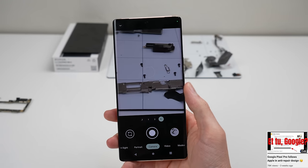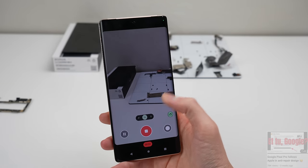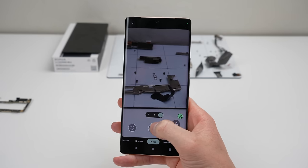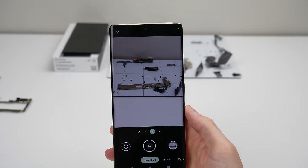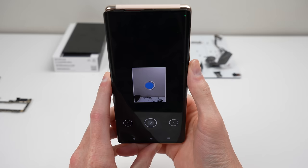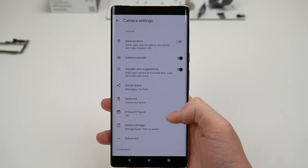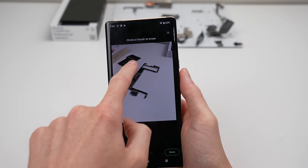Lewis Rossman put out a video recently discussing a document on the Pixel 6 stating the rear camera can only be used for the original device. After swapping the camera modules between the two phones, we can see they are still working correctly. I tested all photo and video modes I could find — including zoom modes, stabilisation, Night Sight, slow-mo, and portrait mode — and they work just as they did before the swap. While Google may calibrate cameras when performing repairs, swapping the camera modules had no negative effect.